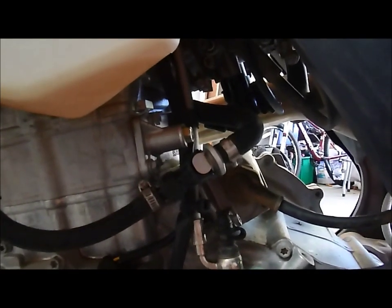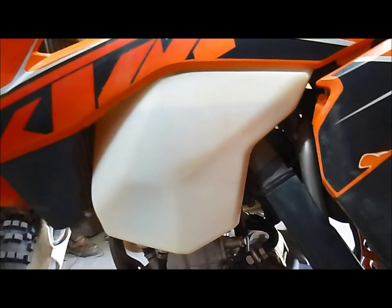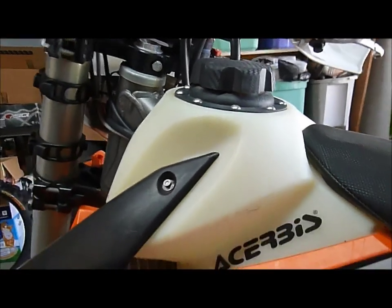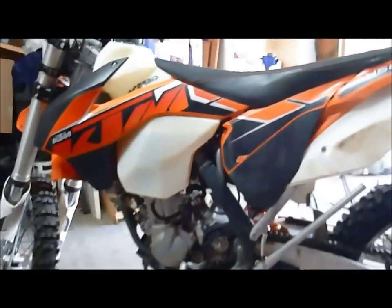Fuel injection, we're going to talk a little bit more about fuel injection, injectors, and cleaning injectors. But I've got to say, this bike has a ton of miles on it. The fuel injection system has never been touched, the injector has never been out of the bike, and it's run absolutely flawless. As for fuel, almost all the fuel that's been through this bike has been Pemex, so I'm not doing anything to take special or extra care of it. I'm not running the split stream filter in the tank because the HRV's tank really doesn't accommodate it well. I do take the little 20 micron filter out and clean it every once in a while, but I literally just shake it out, blow through it, make sure it doesn't have any real obstructions in there, and it's been fine.